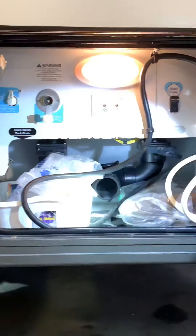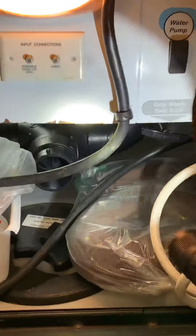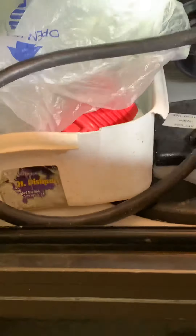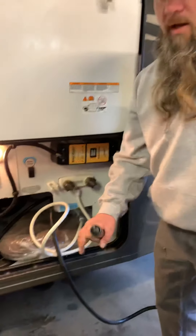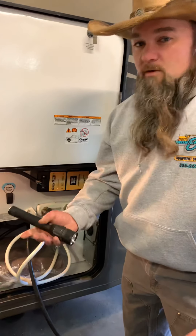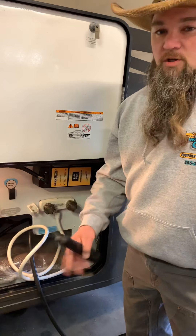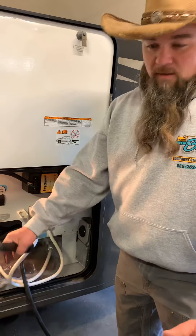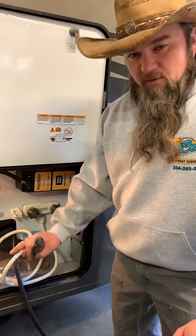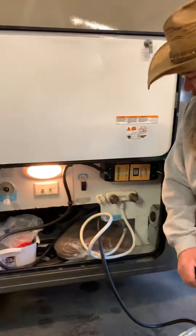Back here is your output for your sewer and your valves. You have your gray tank valve — that's your showers and sinks — and your black tank valve, which is your toilets. When connected to sewer, you can leave the gray open, but you have to leave the black shut to keep the chemical in it for odor control and to break down material. When you're about two-thirds full, shut your gray a bit before that, pull your black and empty it, then shut your black and open your gray to flush out the line with that gray soapy water.